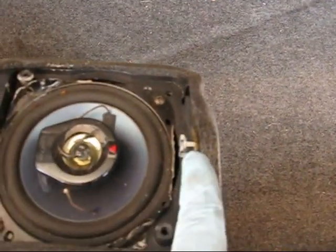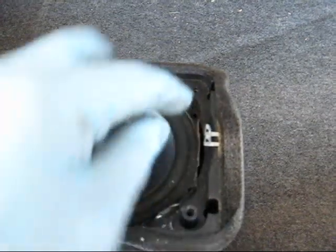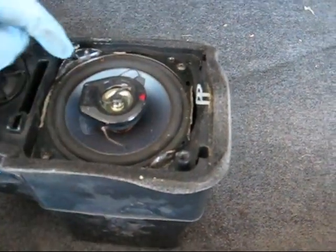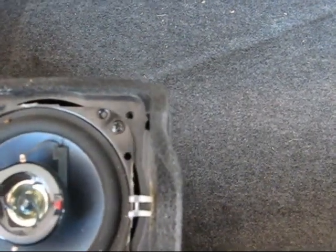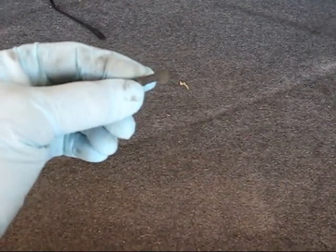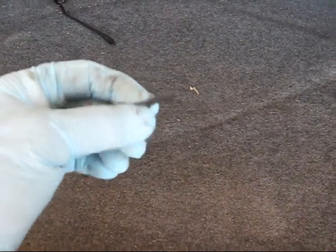There's a clip on the inside of the speaker housing that you have to move over the edge of the frame. Here's the clip — picture this back in the hole in the shelf; you'd be moving this clip to let it drop down, and the other side has a hook that hooks onto the metal of the shelf. This is a replacement Kenwood speaker I put in a while ago since original speakers tend to rot out, especially on this back shelf because it sits in the sun. One of those clips broke off when I was taking it out — even when you're careful, this plastic gets very brittle with age on a 1995.